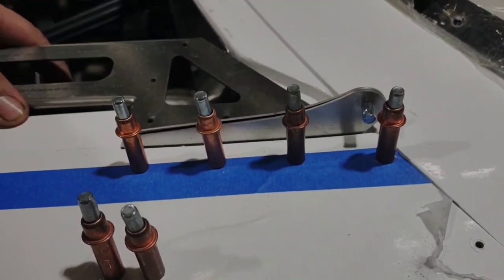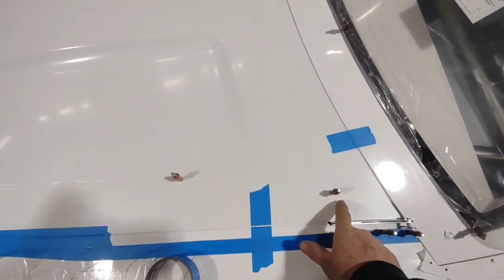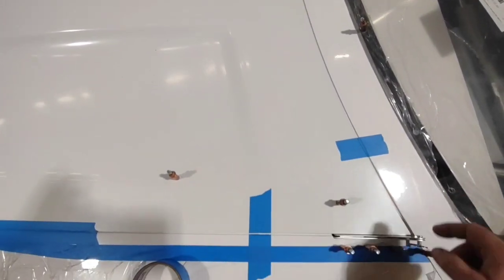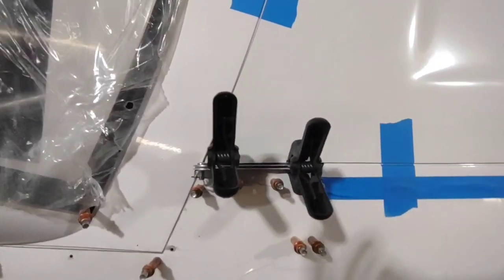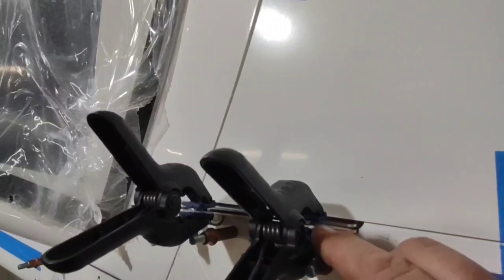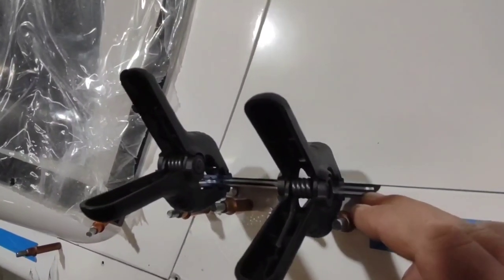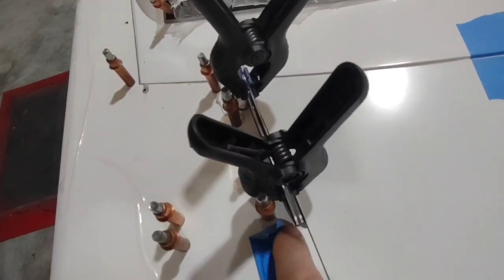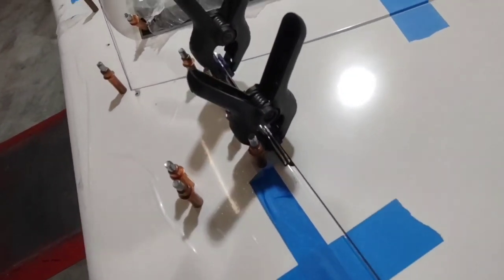You can see from this angle where my hood hinge pivot is, and when the hood lifts up it's got plenty of room to clear the cowl. To locate the bottom part of my hood hinge, I've got my fender side mounted — all Clicoed in and solid. I get my hood exactly where I want it and tape it in place so my gap doesn't change. My gap is absolutely perfect. Then I add a washer in between the two pieces and lock them together with a clamp. This ensures that when it's all done and mounted, I don't have a rubbing issue — there's just enough of a gap that it allows it to move freely without binding every time you open or close it. I've got my relief cut so my fender side of my hinge sits perfectly flat and tight. My clamps are in, my gap is held, and I'm ready to drill from the bottom side up. When drilling from the bottom side up, be careful — if you push too hard, you'll break out a chunk of gel coat. This is really light, thin gel coat, so use a good sharp drill bit and push gently.